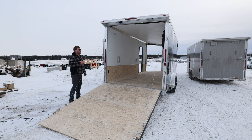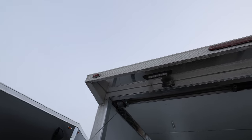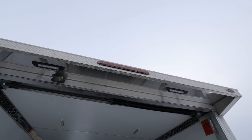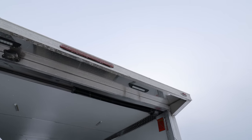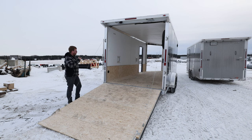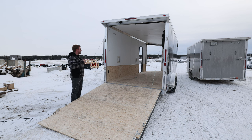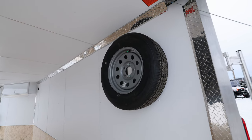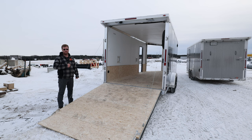This is a seven-foot tall overall height, and we've added that spoiler feature on the back with two load lights. You do have a load light standard on your front ramp whenever you add this spoiler feature. They've talked about it taking the backdraft off your ramp, keeping it a little cleaner for snow, and it also has two LED dome lights shining down on your ramp for loading at night. Down the walls you'll see lights — a couple dome lights are standard. You get a good view of the white wall and white ceiling. We've also mounted a spare tire on the wall — you can hide them in the floor, mount them on the wall, or have them loose, but they are handy to have.